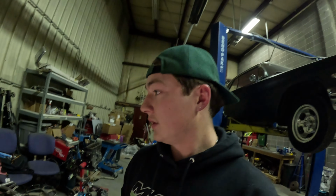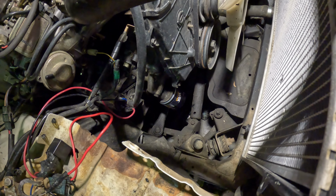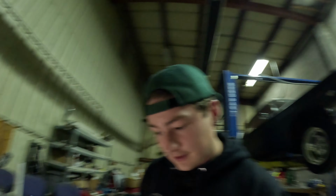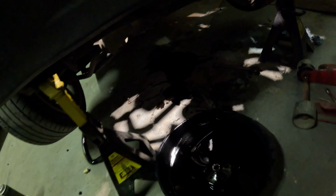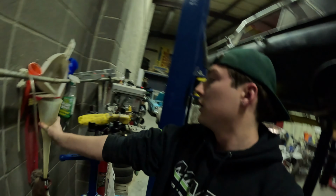I spilled. I used a Wix oil filter. It's gonna be good enough for this situation. Got that Wix filter just sitting nice down there. Got the pan down here full of oil and a mess right next to it for me to clean up later. That's always fun. Yeah, this is dark. Nice. This calls for 4.2 quarts of oil.